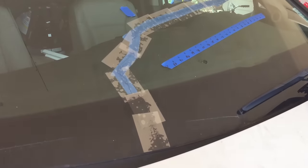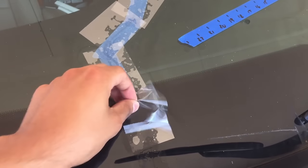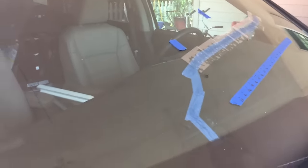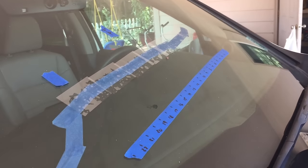We let it sit in the sun for about 15 to 20 minutes on a very sunny day. After that you peel off the plastic strips — if it's still wet, leave it back in the sun, but this is definitely dry. That bullseye looks a lot better. Once you peel them all off, take the included razor blade and scrape at a 90-degree angle — perpendicular to the glass — and scrape hard. It says don't be soft with it. Scrape up the white powdery residue, then report back and see how it looks.